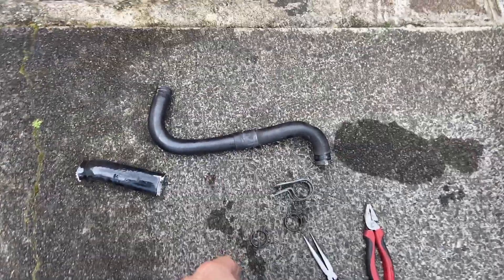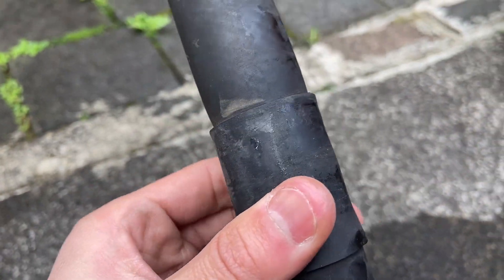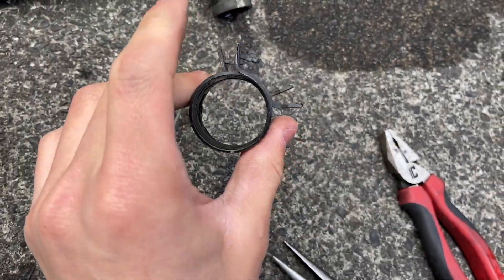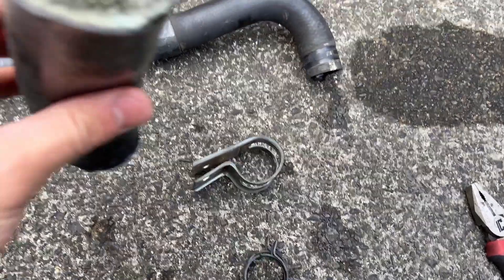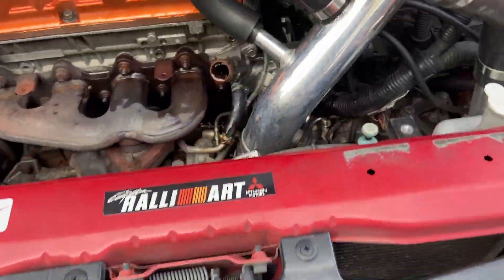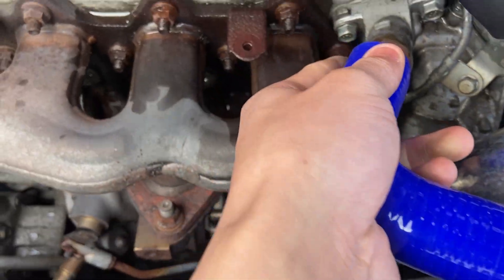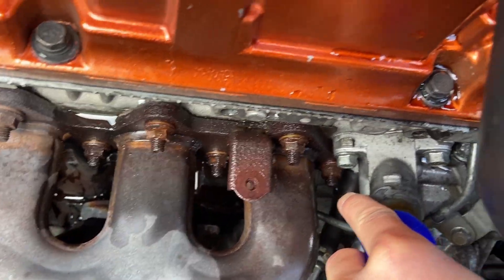The old upper hose is off. We have the hose securing mounting bracket, and the two spring tension clamps which we're reusing. There's also the fiberglass heat sleeving — I'd recommend wearing gloves because if it gets on your hands it gets very itchy. Going to clean the surface a little on the upper hose and the radiator, which has a bit of surface rust build-up. Grabbing the new coolant hose to see if it goes on — it's a little tight.